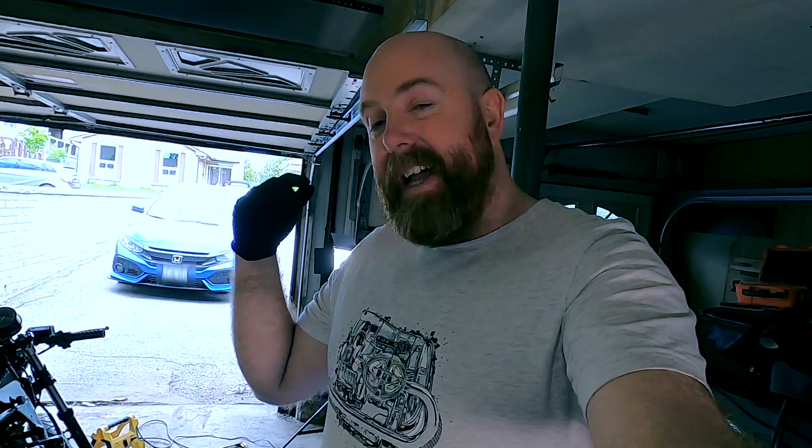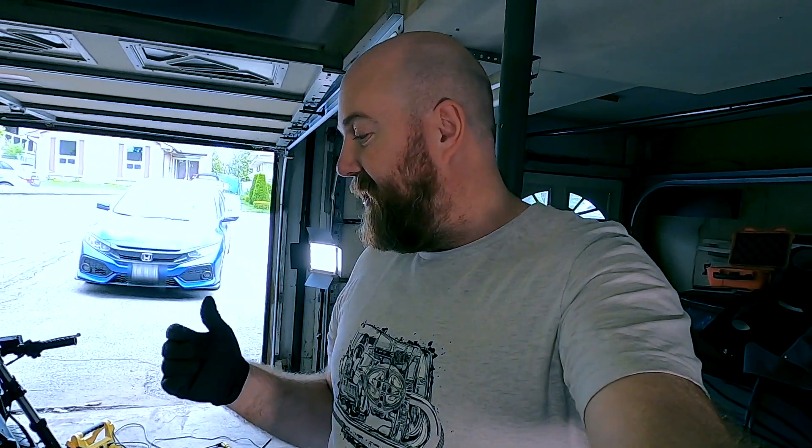So if you remember, we bought a tail light — Dan purchased a tail light for the back of the bike. One of our viewers, John Wright — the right man for the right job, John you're a legend — reached out and said he'd just bought that same tail light and done a little retrofit on it. It's a really nice build quality, but it had an incandescent bulb and was a little flimsy. John lined the inside of the tail light with an adhesive foil tape so it'll be brighter, and he changed out the bulb cradle to take an LED bulb. He also reached out asking what wiring colours we needed for our loom, and he actually pre-wired everything for us.